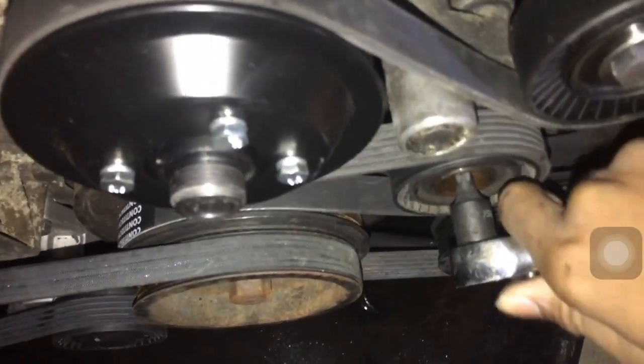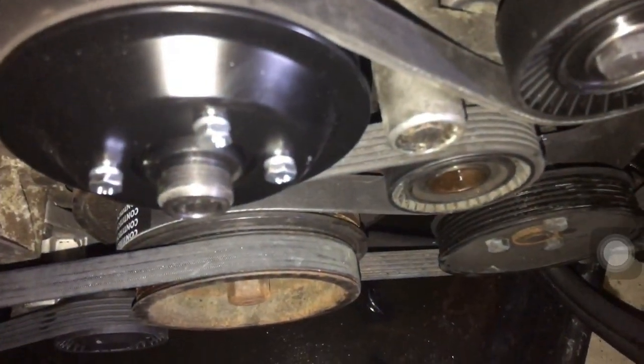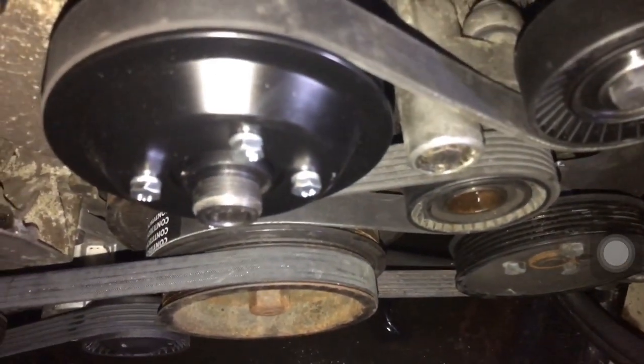And that's how you loosen your hydraulic tensioner on your BMW E39 — I believe it also works on the E46. As you can see, this is just a quick little video putting the information I found on the forum into video form so people can watch and see. Holding down the tensioner releases the pressure due to the hydraulic fluid going through.